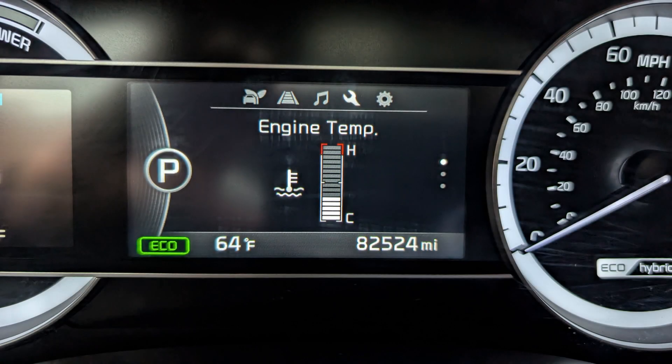That's how you bypass the heat exchanger on a Kia Niro. Time for a little bit of editorial though: this is definitely a perform-at-your-own-risk bypass. That heat exchanger is designed to be there — it's designed to bring that engine up to temp as fast as possible, and I presume to maintain the temp even when you're not doing things that would normally maintain the optimal operating temperature.